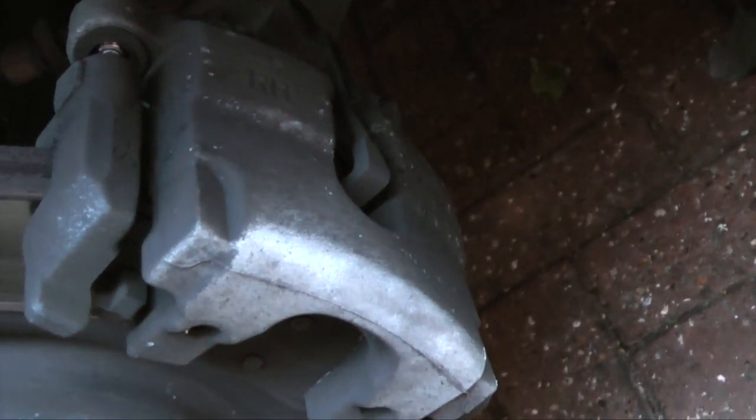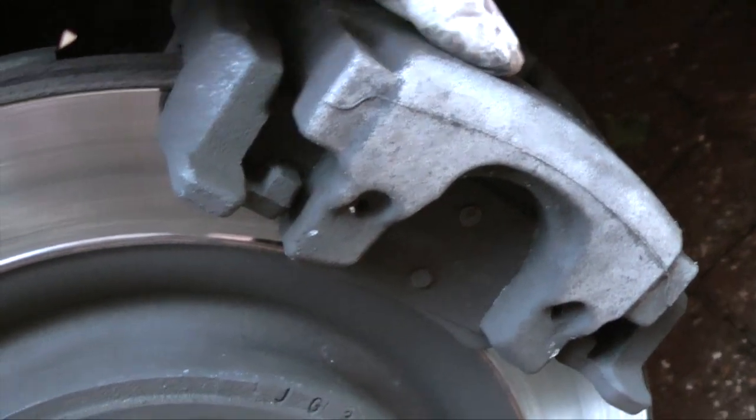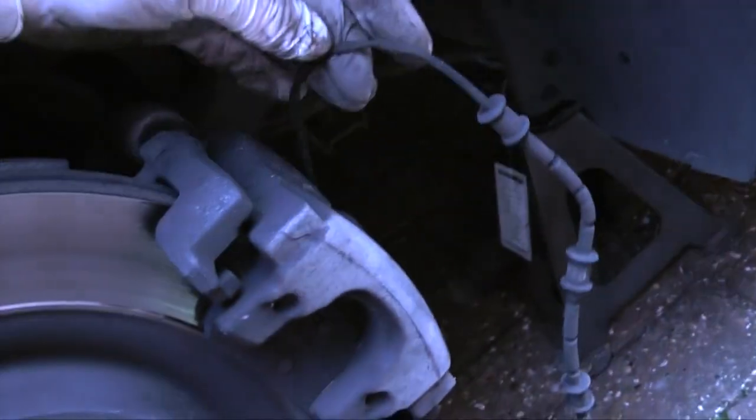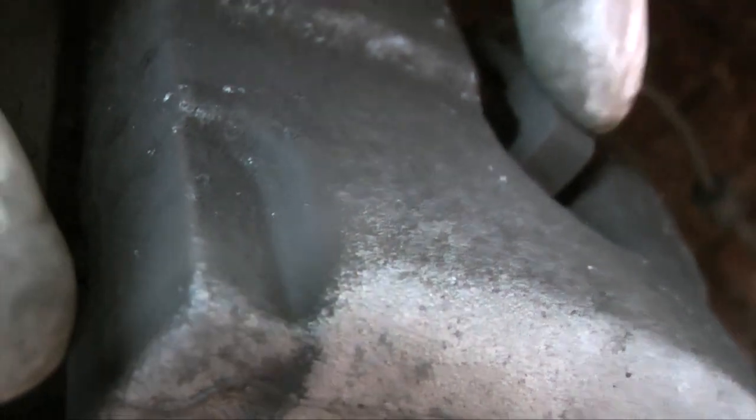This is a British car. On the driver's side — right-hand side as you're sat in the vehicle — the rear is where the wear sensor is. On the front it's the near side. Take it off from its supporting clips gently before you take the caliper away. Having undone your top and bottom bolts, the wear sensor connects quite far inboard. Once it's picked out it will just drop out of the way. You'll need a new one if your car is saying brake pads are low, because the end will have worn out — put the old one back and you'll just get the warning again.